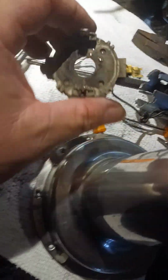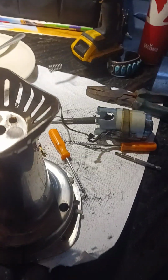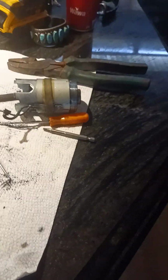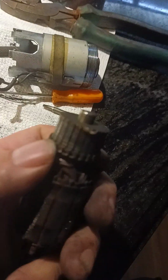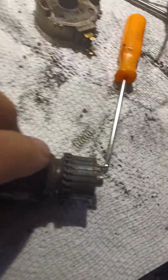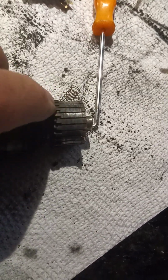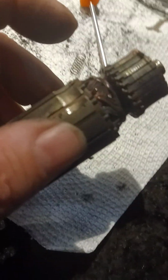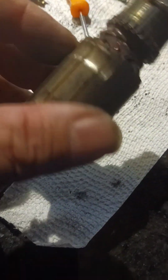Well, guess what? You could show somebody in China, and they're not going to replace that. So I just wanted to see why. You know, it smelled really bad, but it's all from the motor. The motor has two brushes. If I show it to you correctly, you could see this. See how thick these are? This is the way they would be originally. The brushes broke it, pulled it down, and wore it out to where it's like this now. So she's wobbling, she's causing a leak. You could see the wear rate here in this unit because of the wobble, where it had eaten this and this.